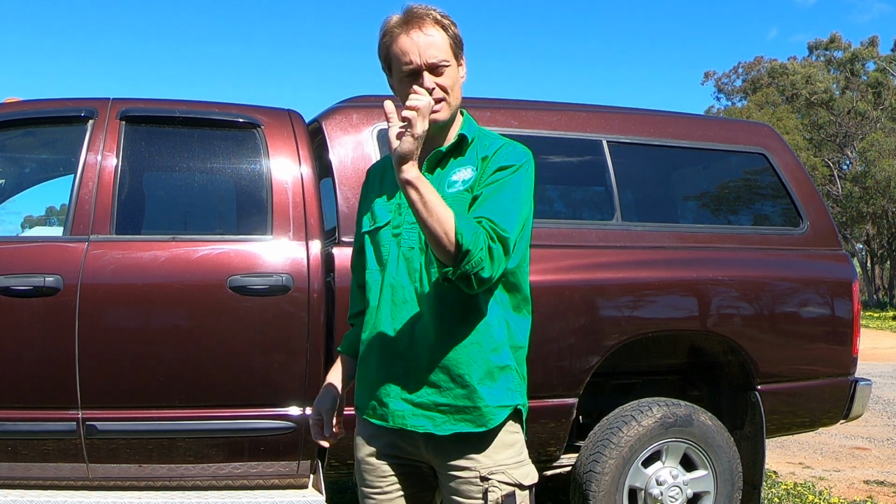So that hotline coming out of the transmission is going to be your most accurate reflection of what your transmission is doing at any moment. Now that's something to consider if you're choosing a transmission temperature gauge.